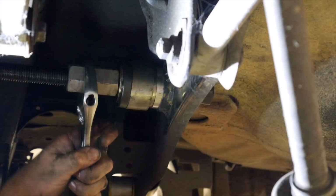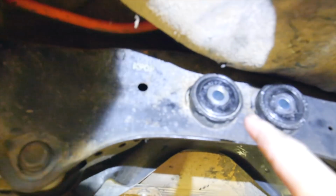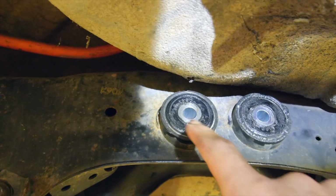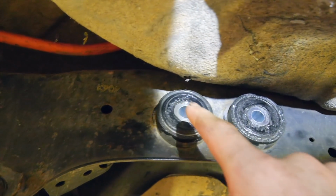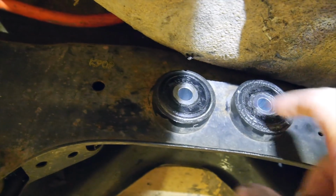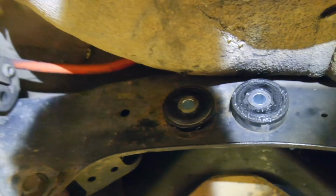So as I said before, lube is key, because you can feel the heat coming out of that already, just from small winds like that. Alright, so you can see the bush is in. The last thing to do is pop these steel inserts in. Just a bit of lube on them, they pop right in. And then just grease up the faces of these, ready to take some nuts and bolts and some diff action.